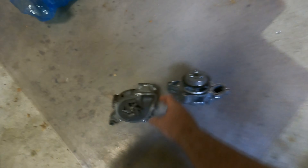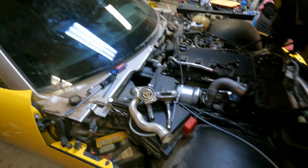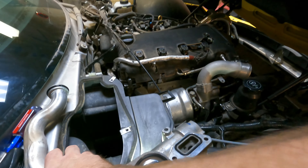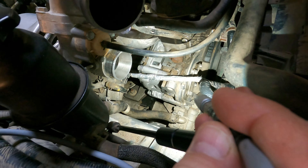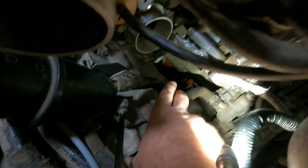It's a terrible pain — let's go take a look at where that's located. I've already got a water pump installed down in there, and you can see the casing on the back side of it. There's the water pump itself, and there's the little window up front that you use to keep that timing chain from moving. So when this water pump comes out of here, first the casing has to come off the back and come out, then the water pump itself has to come out. To do that, you need to take this line that goes to the power steering and pull it out — really pull it out like that.